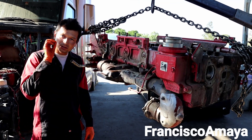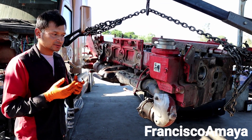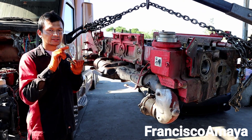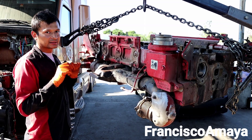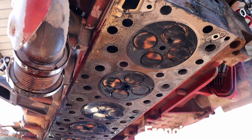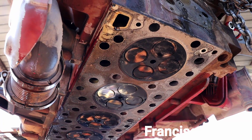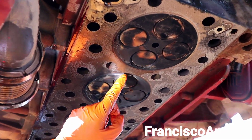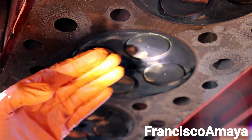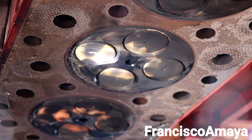It was just a very small leak — not enough to destroy a hose, but enough to notice. The problem with leaks like that is it's really hard to find, but there is only one place to look: the head. On the bottom area of the head, you can see the round marks — that's where the cylinders are. You can see this little mark from the gasket ring on the side, which helps prevent compression leaks from the cylinder head.